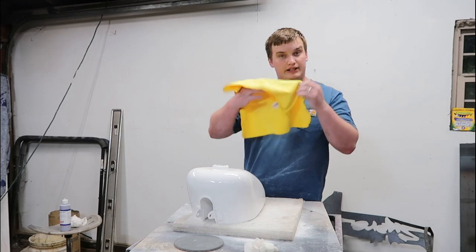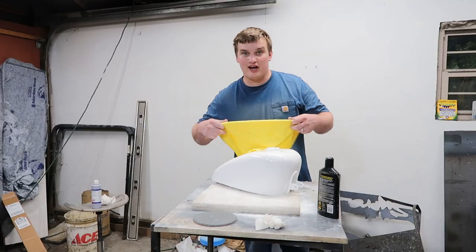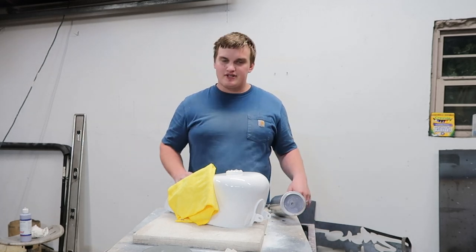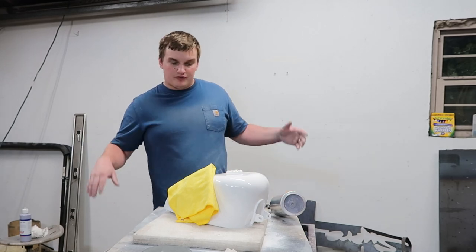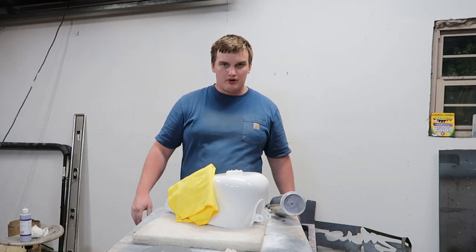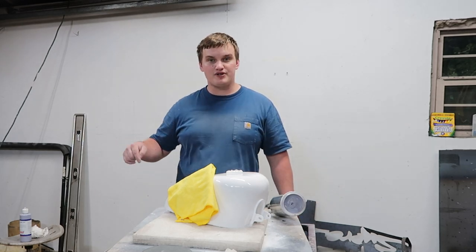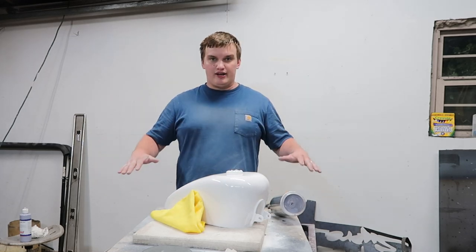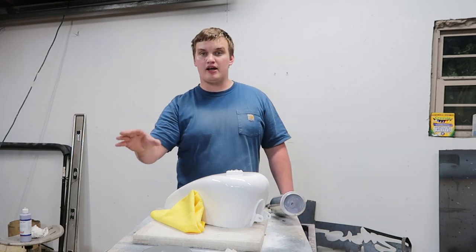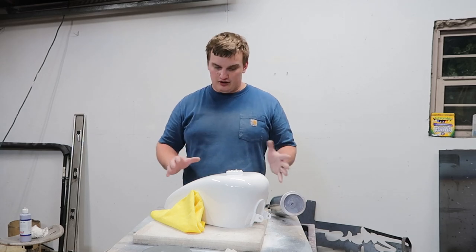After I'm done cutting and polishing with the wheel, I'll get a clean chamois and go over the whole thing — and there we have it. Hopefully this was helpful. I want to encourage you that you can do this in your own garage. Yes, it would be better to have a paint booth to keep dust down, but you can do it in an open garage. What I do to minimize dust is bring my hose in and wet my floors down — that holds any dust on the ground and keeps you from kicking up more. I put a fan in the doorway when I'm spraying and open the opposing window so we have a cross breeze pulling out most of the overspray.